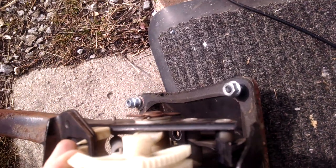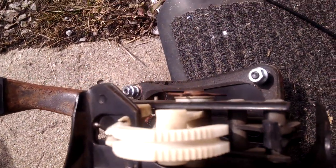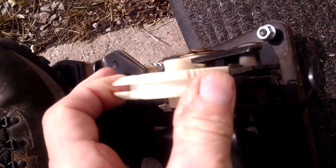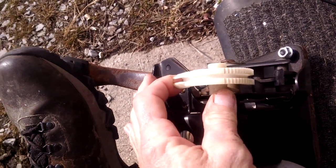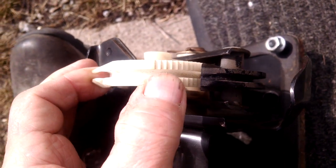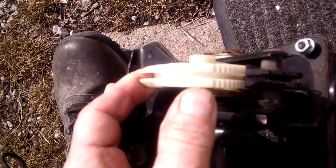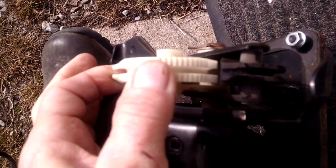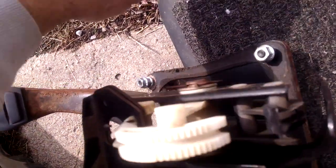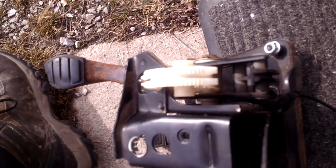The other thing a lot of people don't understand is they hear every once in a while a gronk from the clutch pedal. These tiny grooves, along with the clutch pedal, make up the self-locking mechanism. As I push on the cable and the clutch pedal adjusts from the cable on the inside of the throw-out bearing, this is supposed to automatically adjust your cable. You can hear a sort of stripping sound — what this does is put constant pressure on the throw-out bearing. So this is automatic, and it creates quite an issue sometimes.